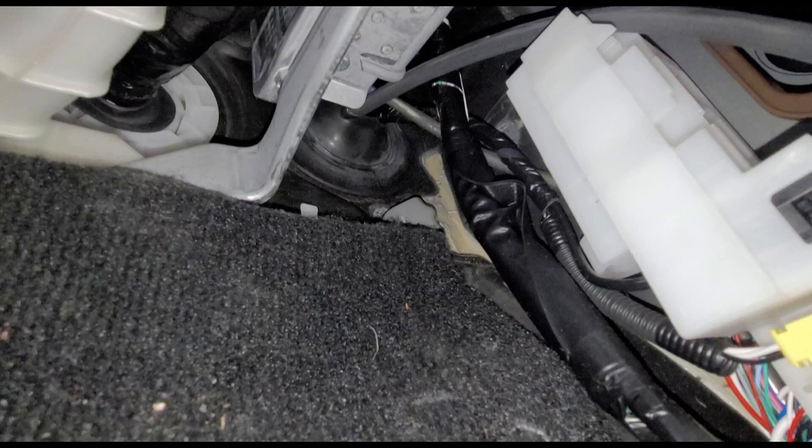This is on the passenger side of the vehicle. There's a plastic kick panel on the outside of the footwell area, and it's really easy to take off. There are also plastic covers over the door sills — the front door and the rear door — easy to take those off, they just snap right off. And then there's a way to pass your cabling through the channeling through the main pillar between the doors, which we'll see in a moment. You take these plastic pieces off and you've got manufacturer-built channeling for their own cabling, with plenty of extra room.